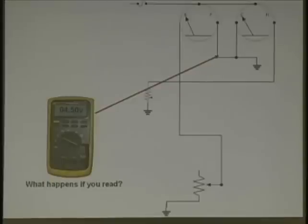You're only going to have what type of problem here? What's the customer complaint? On the fuel gauge. Only the fuel gauge. Why? This ground is still good. You may have the issue right here. Does that make sense, everyone? You got voltage drop right there.